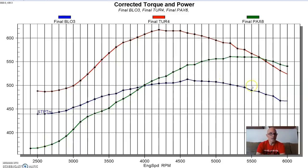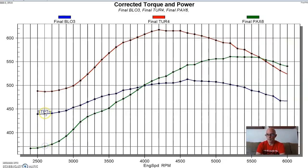That's the benefit of a positive displacement blower: lots more low speed power. Now, the turbo is showing more than either one down there, but I don't think that's a real result - I think it's artificially benefited from the load imposed by the dyno. But you could get turbos to be very responsive down low.